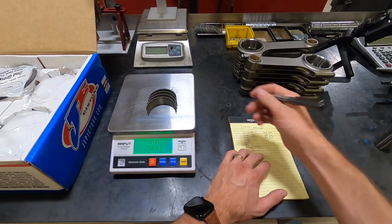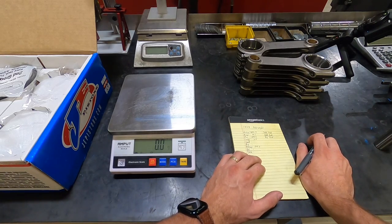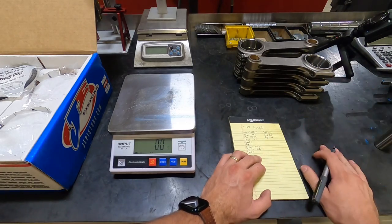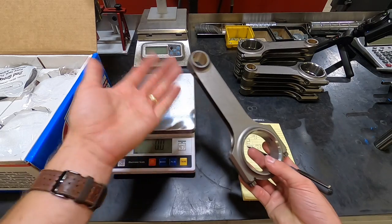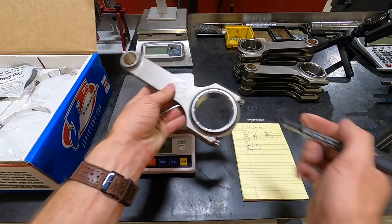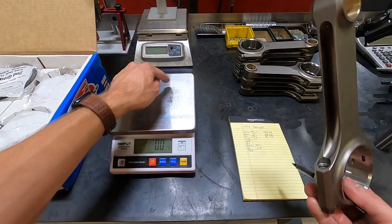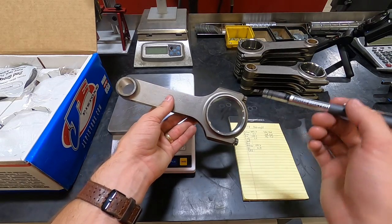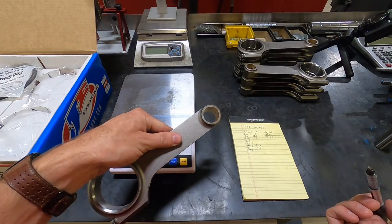We actually give the bearing a little bit of an allowance to accommodate for the oil being slung up on the crankshaft. In a dry sump small block I'll factor in about four grams, and on a wet sump big block I'll give it six grams. Some of these components are what's called rotating and some of them are just reciprocating. The piston, piston rings, wrist pin, and locks all go straight up and down — they're reciprocating. The rod bearing and the rod big end are rotating, and the rotating weights we double. So you saw me put four rod bearing shells on here for my weight. We're going to find the weight of the big end of the rod and double it because it rotates in the engine. However, the small end of the rod, which is up in the piston, we only use as reciprocating and count it one time.